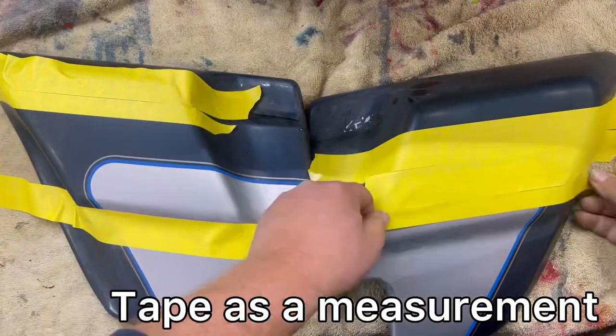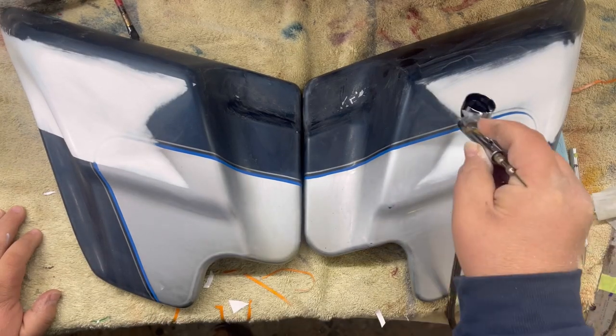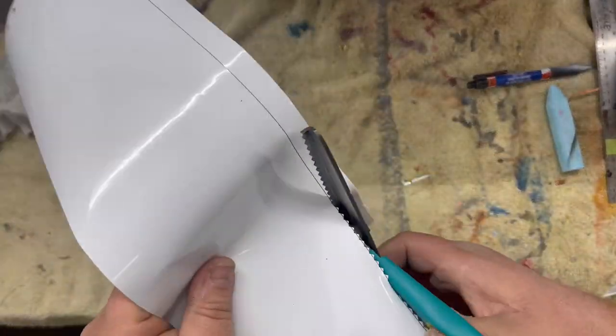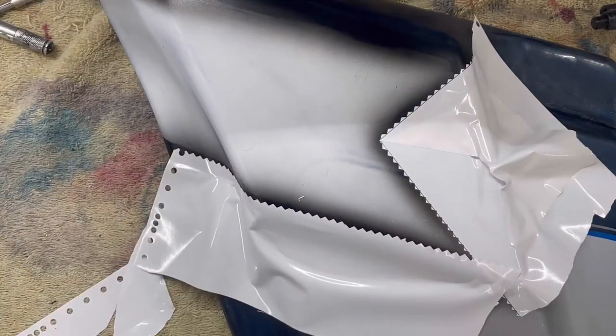On to the side covers. I don't really measure it up — I just use the tape as a measurement, using three-quarter inch tape and two-inch tape. I go ahead and paper it all up, dust some white on there over the whole thing, then I look at my reference and realize I screwed up. So I untape it, sand it down a little bit, put some shadows on, then get out the pinking shears and do a nice little cut. I'm not trying to make it perfect — each little up and down may not be perfect, and that's okay. It's going to look hand-done.